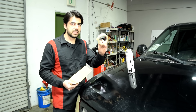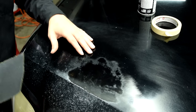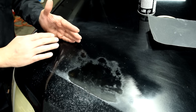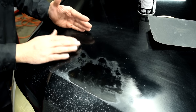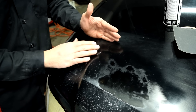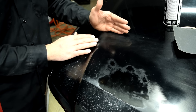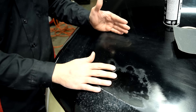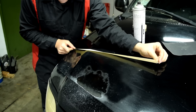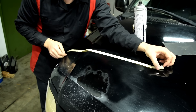If you're new to this, I recommend using masking tape to create boundaries for your repair areas. We're going to be sanding this area down with 220-grit sandpaper. After that, we apply primer going past a few inches to make sure we cover everything we sanded. Then we sand that down with 400-grit sandpaper, going a few more inches above, because over that we're going to be applying base coat. So get yourself some masking tape and create a boundary below which you're going to sand with 220-grit.